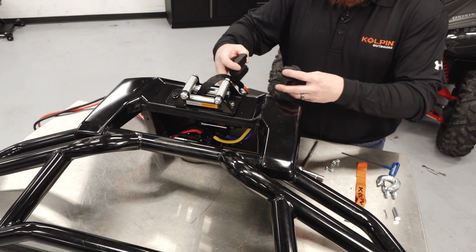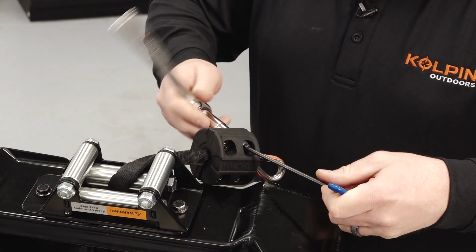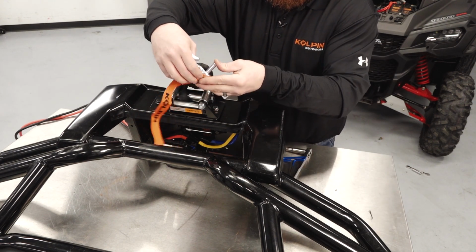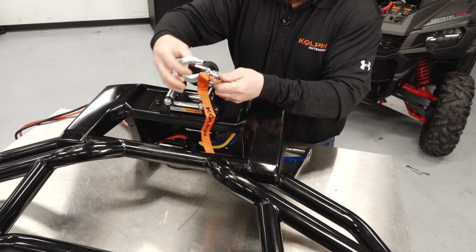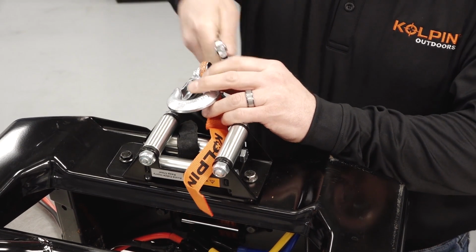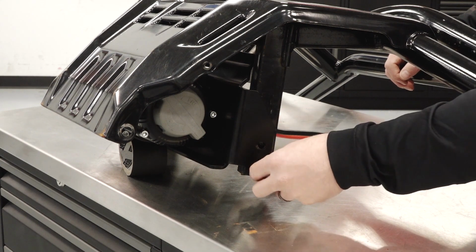The recess will be facing outwards towards the winch hook. Snugly tighten the M6 screws. Install the clevis and hand saver strap onto the rope end. Use the pliers to bend the cotter key into position. Before we reinstall the bumper winch assembly back into the vehicle, we'll want to remove the temporary alignment bolts.